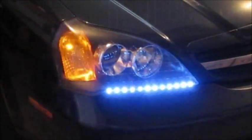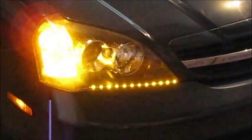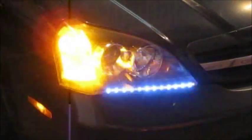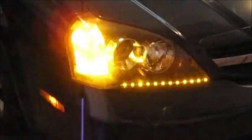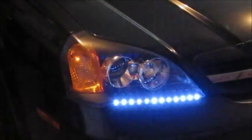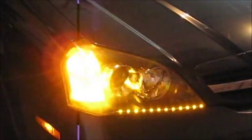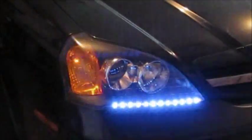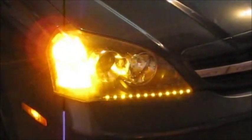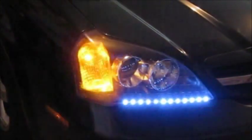What this method does with this product is it cycles the color. The reason that's important is — notice how bright that white is. When the amber lights up with it, it's extremely hard to see from any distance, which defeats the purpose of the whole modification, because you want it to be more visible and you want it to look cool. When the manufacturer drafted up their wiring diagrams, they specified having the white light on all the time and the amber coming on with your signal light. What's happening here instead is they're cycling and alternating the colors, because when white and amber are on together it just makes a weird browny color that really doesn't do much.